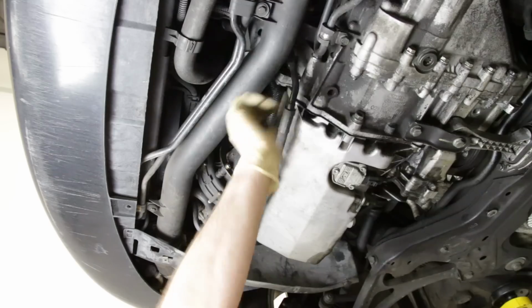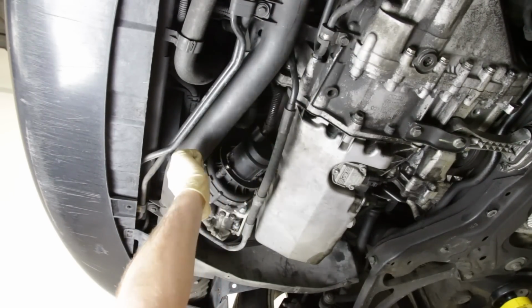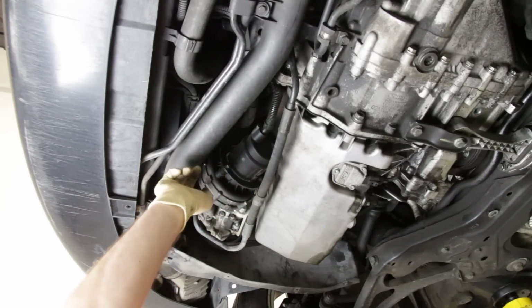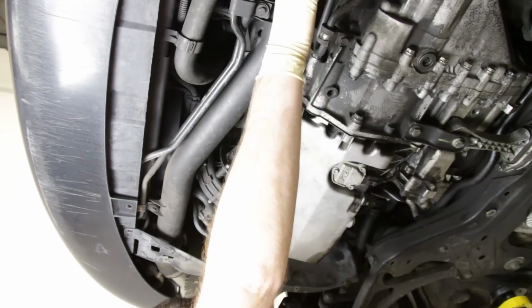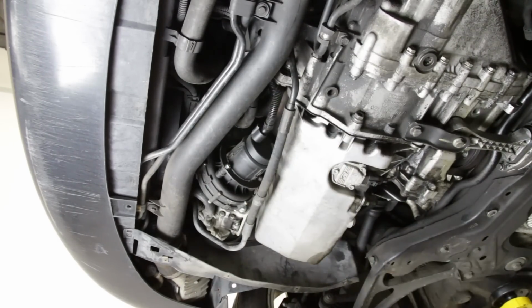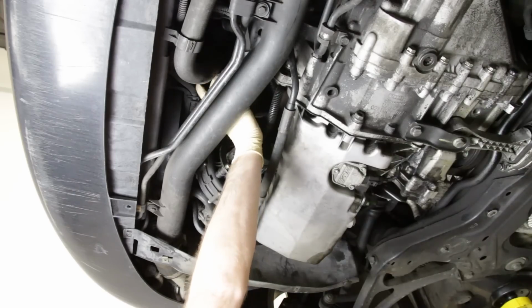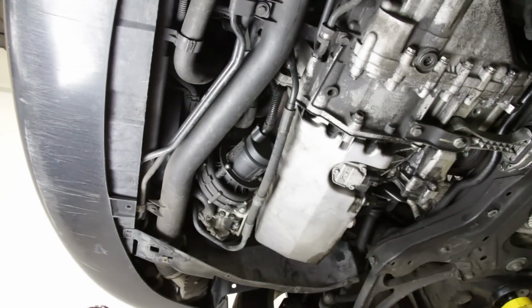And this is your boost pipe that crosses over. This goes from one intercooler to the other intercooler, which if you have a 180, you don't have this because you don't have two intercoolers. So there's one on either side that runs here and then here. People at one point were doing retrofits to have two intercoolers on the cars, and they would often do it if you swapped to a K04 on 180s back in the day. Oil filter here, you can check to make sure you have no leaks or anything there, which I wouldn't suspect.